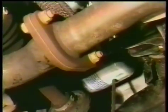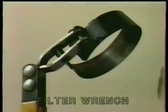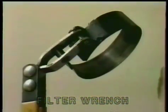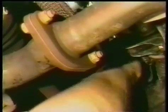And now if you look up to your right, you will see the oil filter. Well, we recommend using a filter wrench because it will give you equal tension. After you loosened it, reach up there, turn it out by hand.